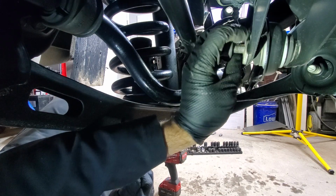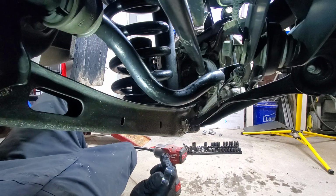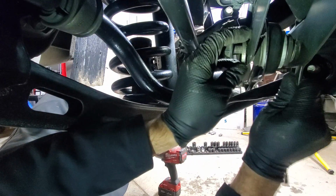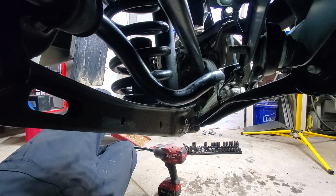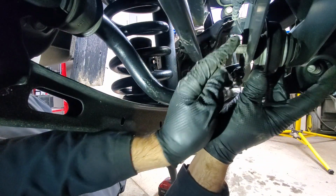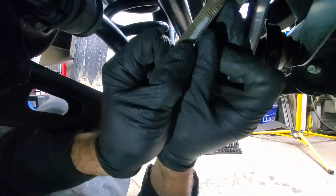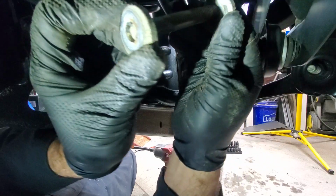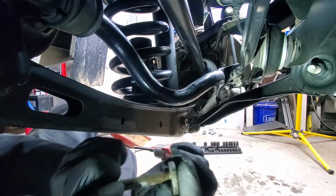This bolt has like 2 flat spots. You need to make sure that this washer is moving freely. Normally what did the trick for me was trying to tighten this part, and then this got loose. So you just move the bolt, make sure that this washer is loose, because otherwise it will be binding and you won't be able to get that bolt out. So now it should slide out quite easily. This side it's welded, this eccentric washer, but on the other side you can see there is that groove, so it moves all together, and if it binds a bit it will get stuck. So this is how you remove it.